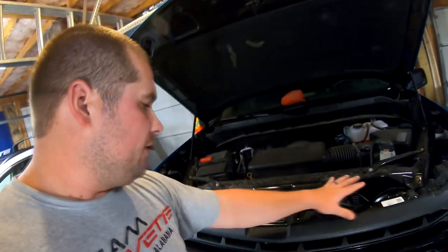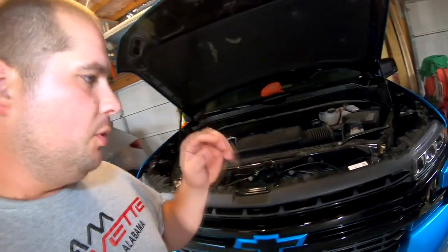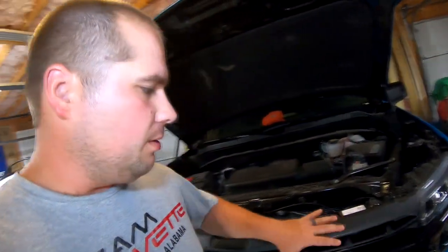As you can see, we've got the full shield off — or pan, or whatever you guys want to call it — right there on the floor. We've got our handle off for the hood latch. And now we're left with this open cavity behind the grill. What's left is just pulling off a few 10 millimeter bolts and then we can pull the grill out.